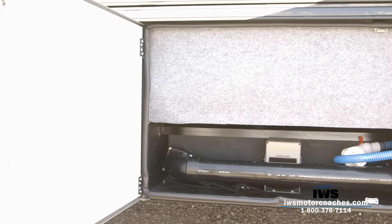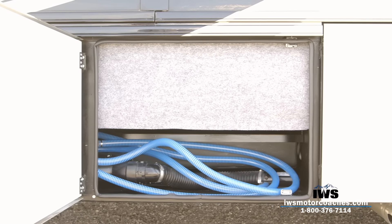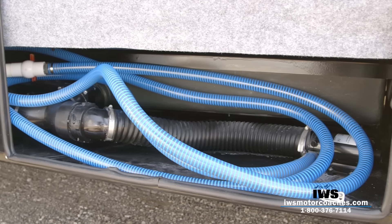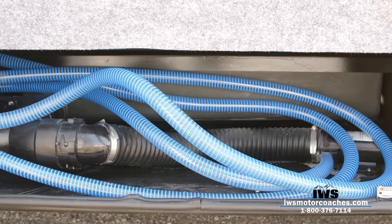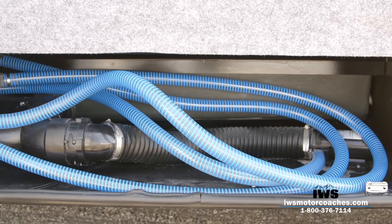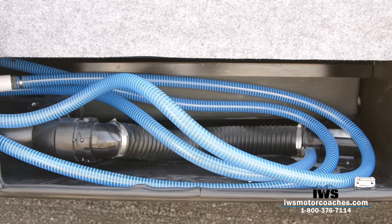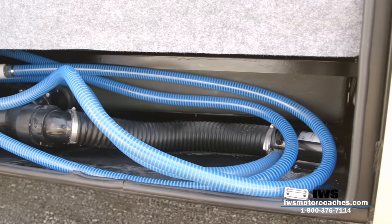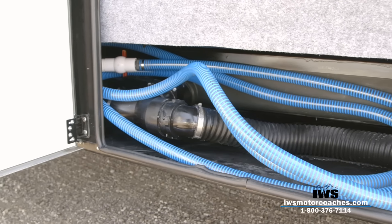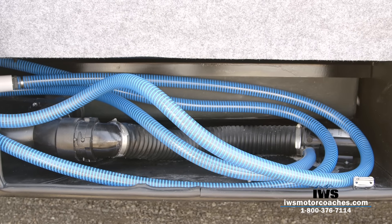As we move into the next compartment box back, you'll see these two doors — behind them is where the septic and black water tanks are stored. As you can see, we've equipped this coach with the macerator sewage system. I've said it a lot before but I'll say it again: we absolutely love this type of septic treatment system. As the black water comes down through that black hose there, it goes into a grinder that grinds up and emulsifies all the product, then pumps it out through this small blue hose. Last weekend up in Helena, a couple of campers next to me came over and wanted to know about the macerator system. They said, 'It's really that easy?' I said yeah, just grab that blue hose, put it in the pipe, turn the switch on — and when we were done they didn't even realize they had just pumped my septic out.